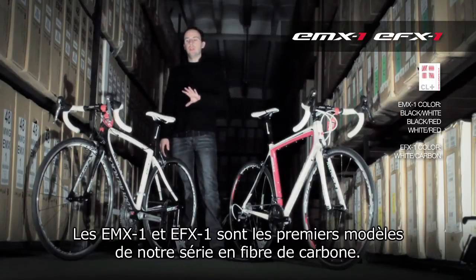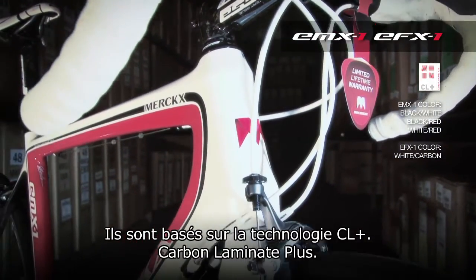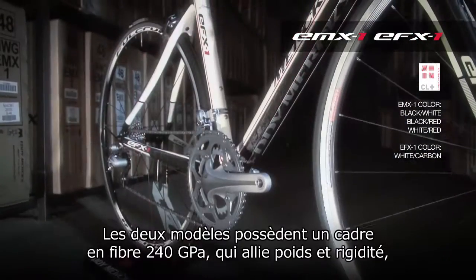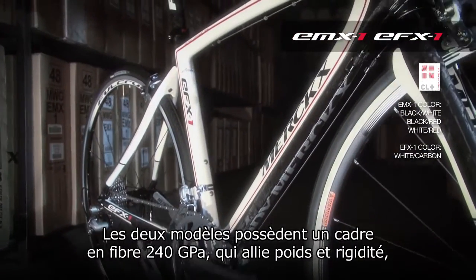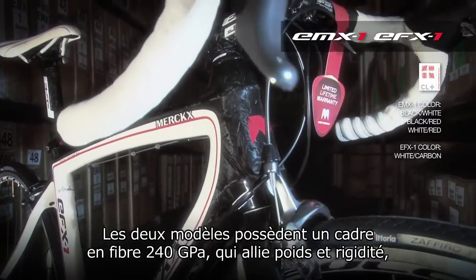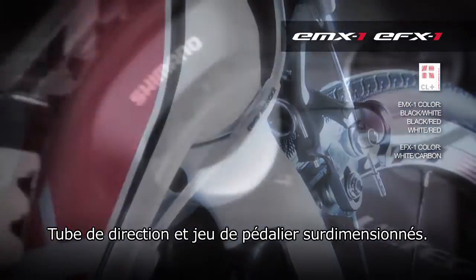Both EMX1 and EFX1 are the first models in our carbon fiber range. EMX1 and EFX1 are built around CL Plus technology, carbon laminate plus. Both are using a 240 gigapascal fiber throughout the entire frame. 240 gigapascal combines weight and stiffness to get the best of the performance out of these bikes while using their unique features: oversized head tube, oversized bottom bracket.